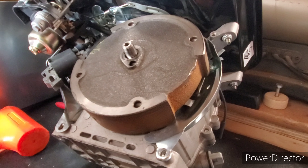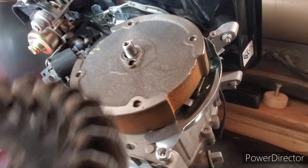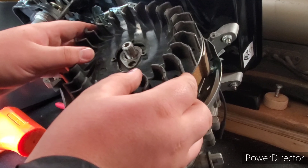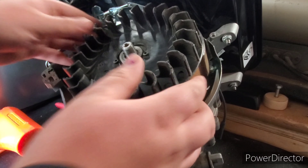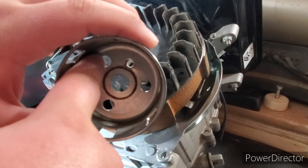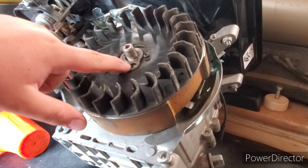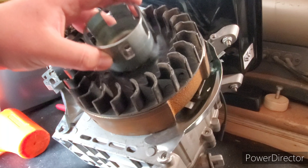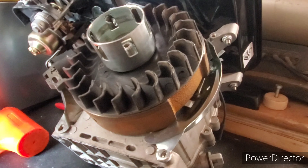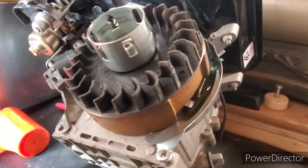Next, take the parts from the assembly — like your fan and your starter coupling — and place that on there. Take your starter coupling and align the three dots as well as the little keyhole. The keyhole goes right here, and then the three little spaces — place that on there and make sure it's nice and snug so it doesn't move. Then hand-start your bolt.